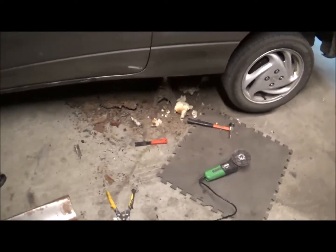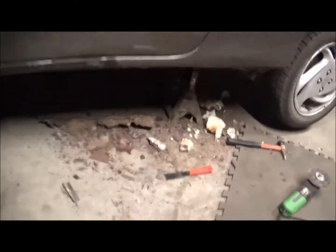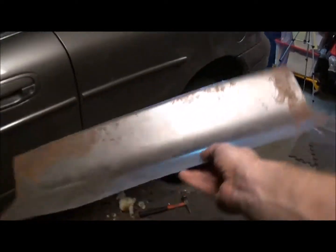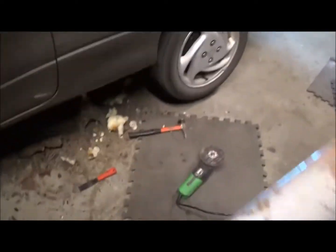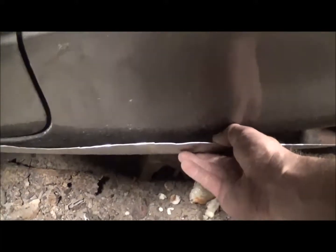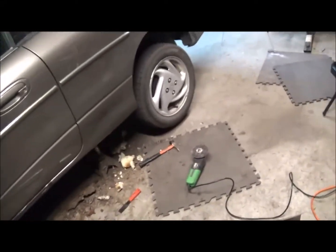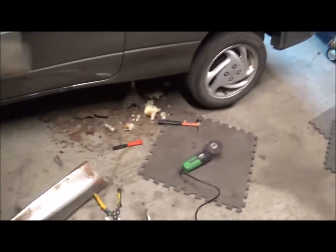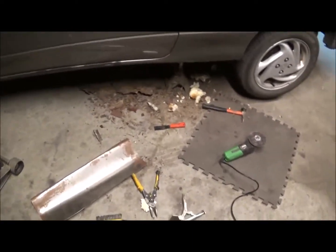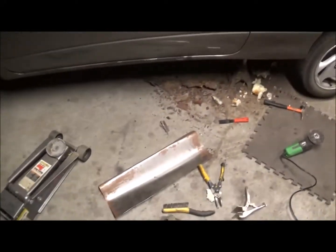With this particular piece of sheet metal, what you do is you kind of overlay it — you put it over your piece and sort of shape it to how you want it. You can actually tune it in a little better as you're putting it on. If you get your general shape, especially if it's not a show car and you just want it to be decent and look right, this is the way you can do it. Just overlay it to get your general shape and then tune it in a little bit later.